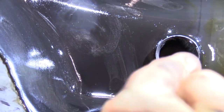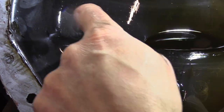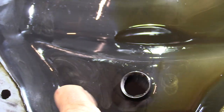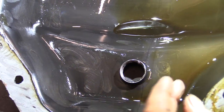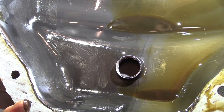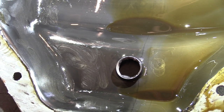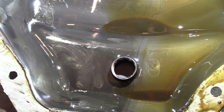That's the break-in situation — those sparklies are going to cause a lot of trouble for your bearings down the road. On the top half of the cover, you can also see where the oil level was, and this black stuff here at 30,000 miles is all oxidation. That's the oil beginning to break down from heat and oxygen. The longer you run that oil, the more black oxidation you're going to get. AMSOIL resists that thermal breakdown like no other, so you'll have a longer service life and a lot less wear. And the neodymium gold plug is going to help pull more of that metal out of the differential.